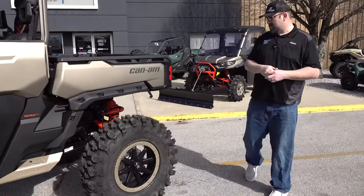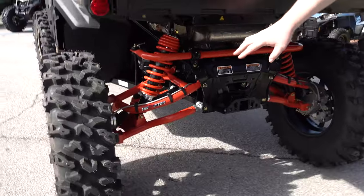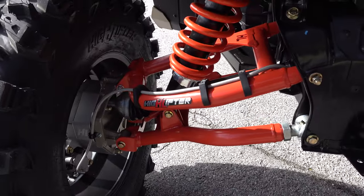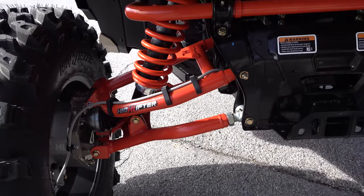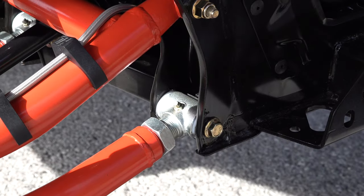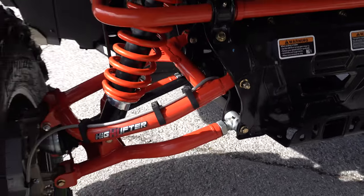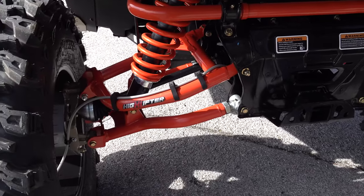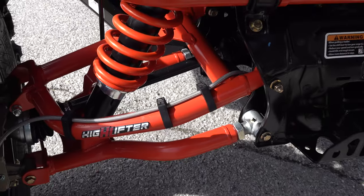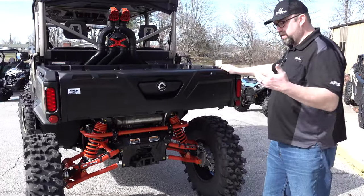Coming around the back — in the rear, we're talking about these huge gigantic A-arms set up here. They are adjustable on the bottom so you get the right camber. These are huge heim joints — almost twice as big as the heims I see on other companies. When we locked those in, we were cranking on them with about a two-foot wrench to tighten that up, so it's not going to move or have any problems. Again, nice brake line clips on here to help hold the lines up where they need to be, out of the way — not a zip tie, but a little bit of effort. A lot of other manufacturers don't put that effort or thought into it.